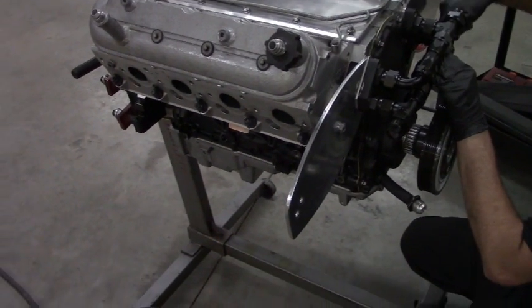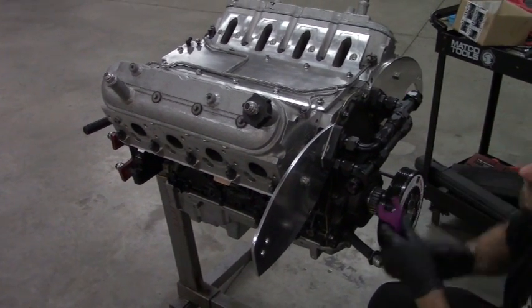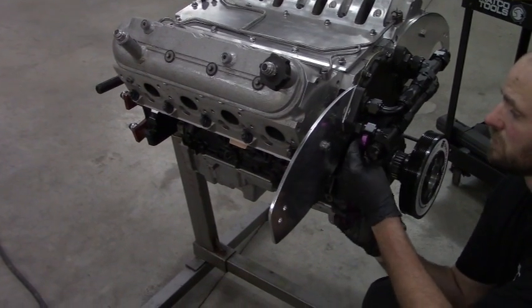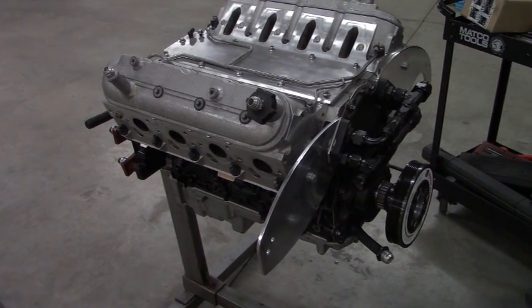But let's kind of go over what we did again. Placed the rings on 2 of the cylinders. We've done more, but that's all they had in stock and all we could get. I know some people were like, well, if you're going to do it, do them all at once. But you know, the race is coming up, and not like we had much of a leak down on other cylinders to really be worried about.